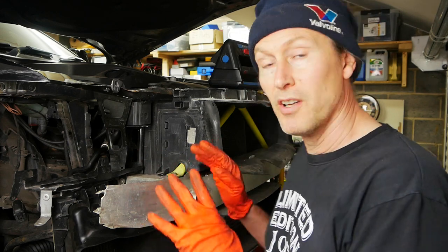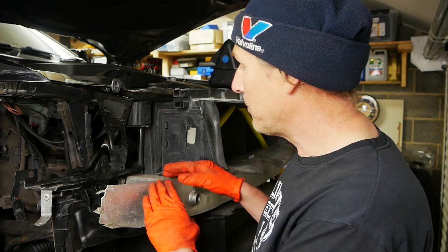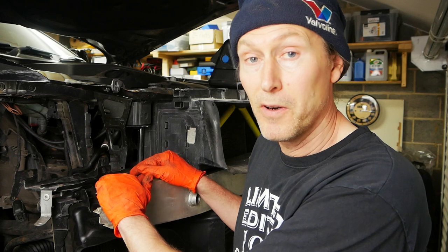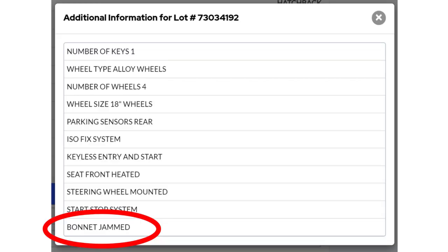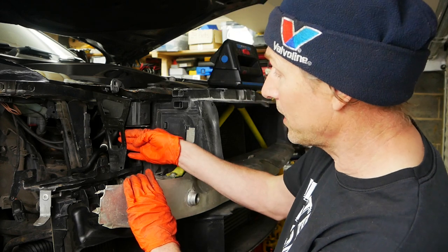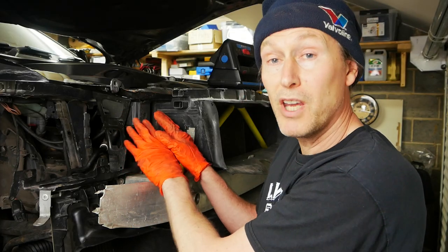This car has clearly been crash damaged before, and when you're repairing crash damaged cars it helps if you're inquisitive and keep your eyes open. Yes, I've been focused on the obvious stuff - the tie bar, a new bumper on the way - but little things like a missing screw on this oil cooler will make it move around and might fatigue the oil lines, causing a problem further down the line. Also this bracket's bent here - on the Copart advert it said the bonnet will not open. I managed to get it open with some effort, but we want it to work a lot better than that once fully repaired. I think this steel bracket is contributing to it, because one of the bonnet latches sits right above it - if it's even slightly out of position it might make it difficult to release.